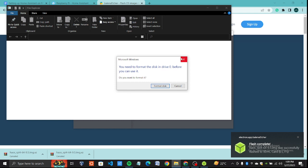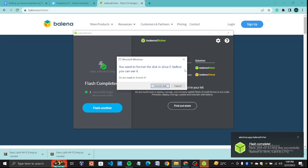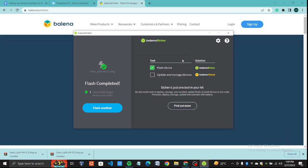Okay, so that's done. Once the flashing process is done, it would pop up this thing. Don't format, don't do anything, simply cancel it, and that's it. Everything is completed successfully so far. So meet you in the next video in which we will be connecting the Pi to the router. Simply unplug your SD card now. You're good to go.